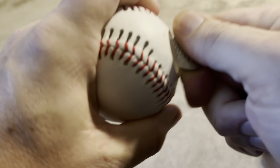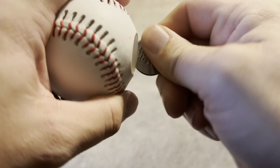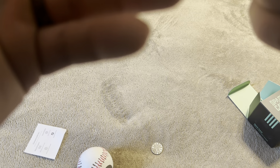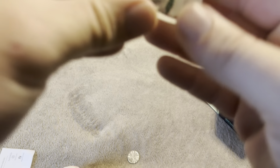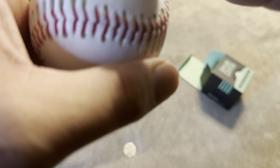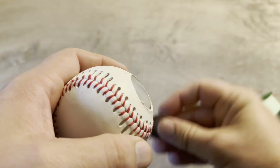I'm assuming you just need to turn that to pop it loose. It was already loose. There we go. You can see the battery is going to need to go somewhere in here. That just kind of pulls out, and then I'm just going to slide the battery inside. This is just going to go right back down in there. It's not going to take a normal battery, so that is something to keep in mind. It only goes in one way — it's got little clips. Then you turn this to tighten it up.